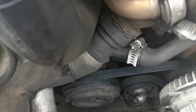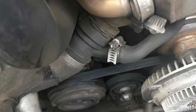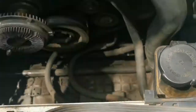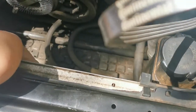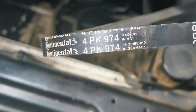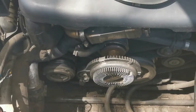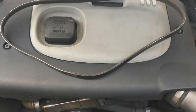So this is telling me that this belt is definitely not the right size, so we're going to see if we can find one that's just a bit shorter. Hi guys, okay so we are back with the new belt. As I suspected, the belt was too long — the one we had there was a 4PK1000, and this is what it's supposed to have, which means that other belt was a full 25 millimeters too long, or two and a half centimeters too long. So let's put on this new belt and see how that will work.